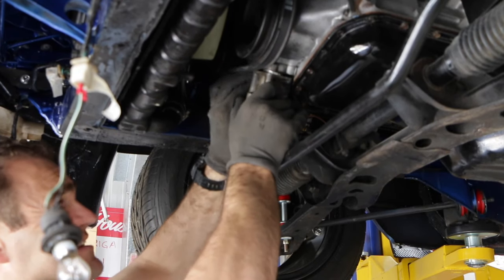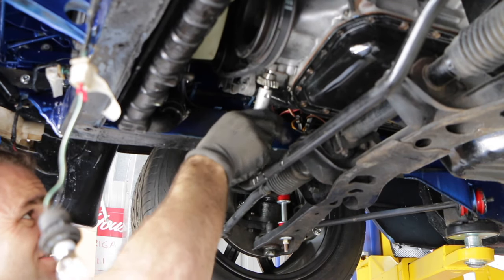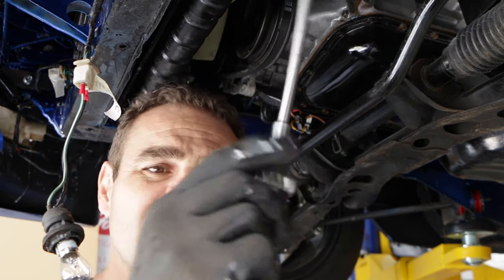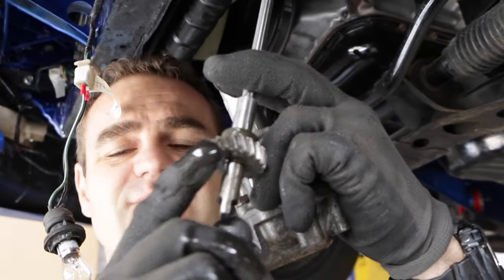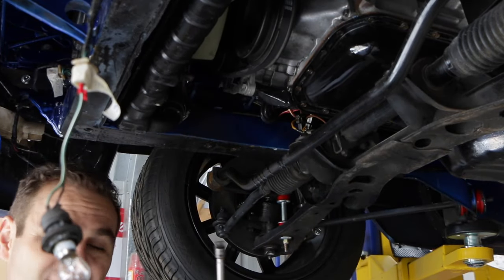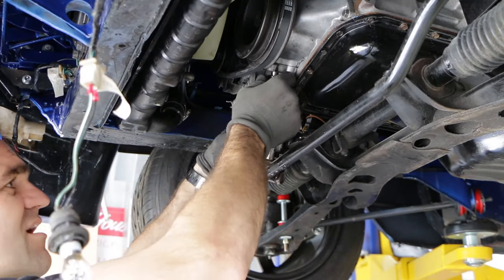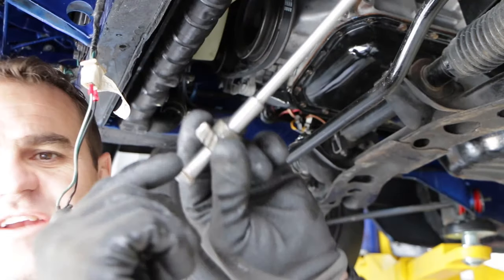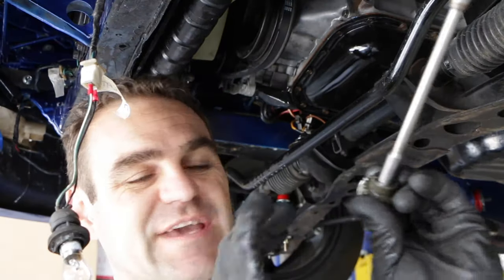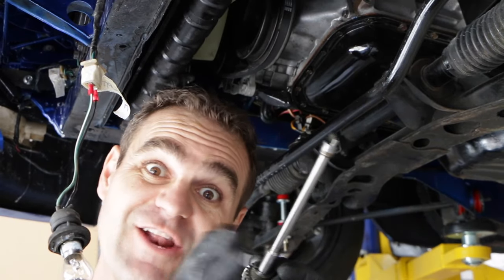Let's remove this oil pump and turn around this drive. This is the drive shaft — it was just cocked one or two cogs out. So now I need to try and put it back in and get it lined up correctly, and hopefully that means it'll work properly this time. What I've done here is I've got the texta out and marked the tooth that I want facing this way. Hopefully it will help me line it up when I'm wrestling it back in around the sway bar. Let's see how this goes and see if I can get it lined up properly.